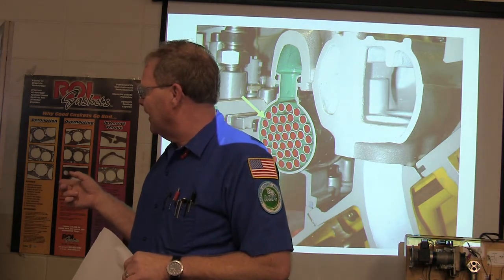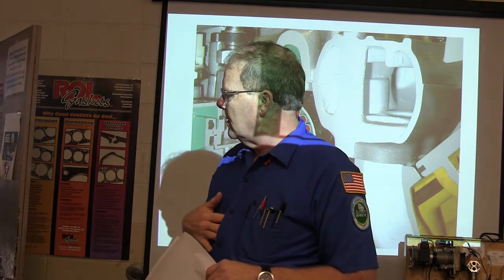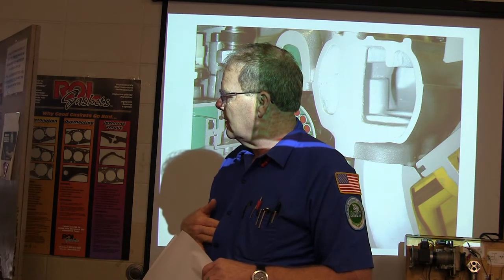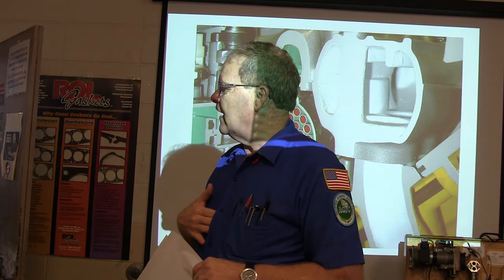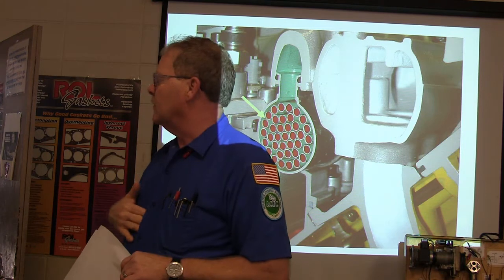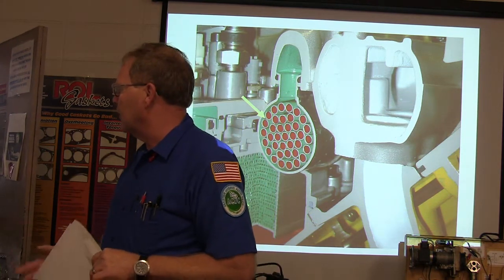We got some issues. What is it? Okay, when it shot out its first trouble code, it had a desired idle speed of 650 RPM, and it's idling at 1900. Okay, so it's actually idling too fast now. Does that one have electronic throttle control on it? I believe so. Okay, so we got an issue going on with that. All right, keep working on that, see if you can figure out what the reason is for that.